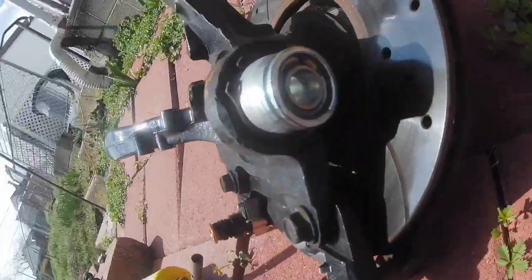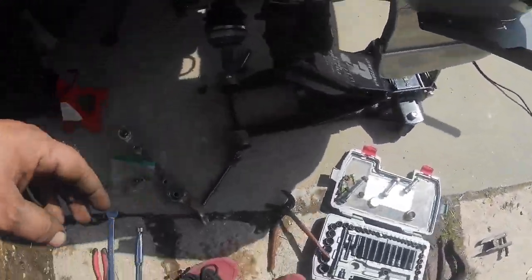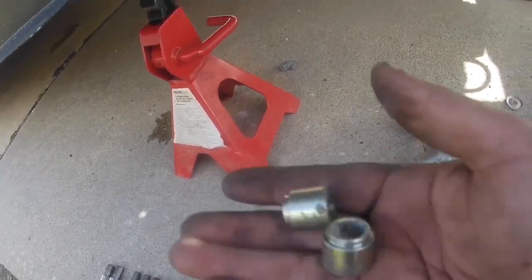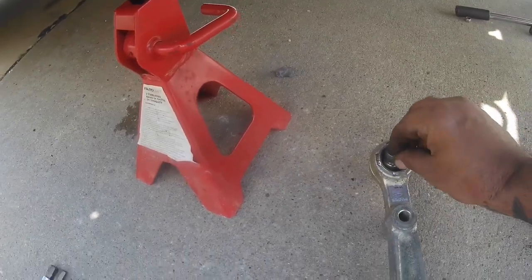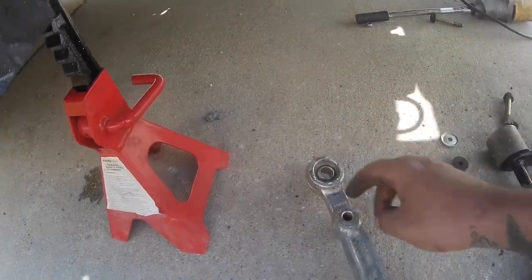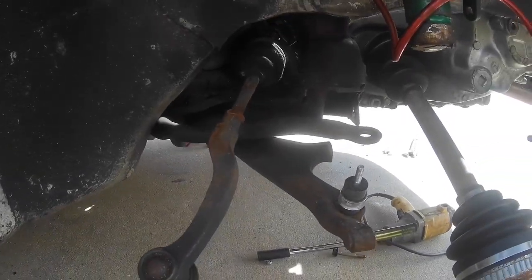That sleeve just has to get pushed back in and then I can put the ball joint into the new control arm, but it's super hot right now. While I'm waiting on that, I'm going to work on the Skunk2 arm — there's a little sleeve for each side that just kind of sets in the bearing. I'll put those on now: a nut on one side and a bolt through the other side, and that'll be set. Then while I'm waiting for the other piece to cool, I'll start working on the inner tie rod.